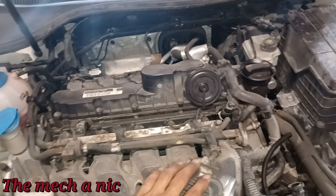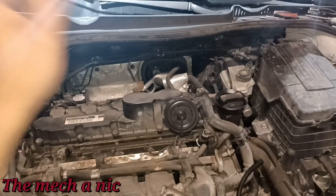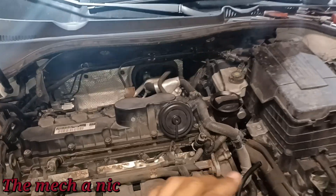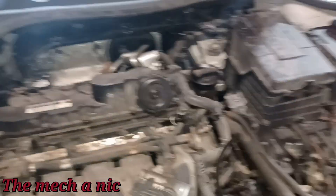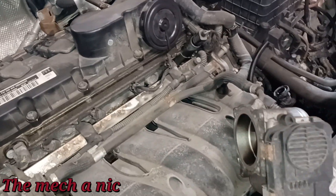What I'm going to do is go ahead and clean out this throttle body and then put everything back together. I'll look at the MAP readings after the throttle body is clean and the engine is running, because I took a screenshot of what the MAP sensor was reading at idle before I took anything apart. We'll go ahead and compare it - the only thing that's going to change between the two comparisons is the throttle body being cleaned.